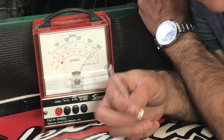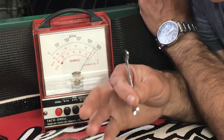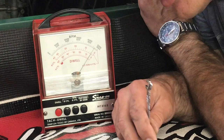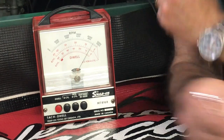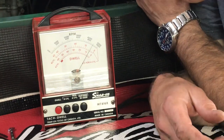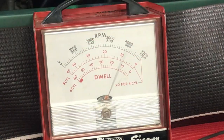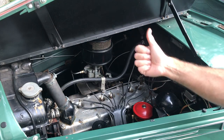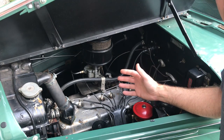Not to dwell on the topic of dwell, but I'm not going to show a full video on how to set the dwell and distributor - most people have done it. It's tight and dark down inside the engine bay. Best place to do that would be on a bench with good lighting. I've been in there with this little micro-wrench, just adjusting it - trial and error. This is my third setting now. After five attempts to get the dwell at 38 degrees, I thought something's wrong. I just can't get it to set right.